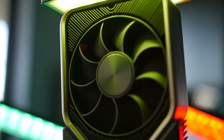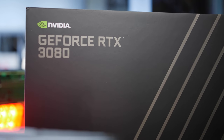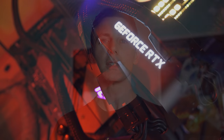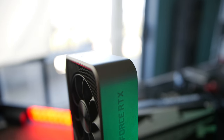In today's video I've only shown two models out of the whole series. The models I had here were the RTX 3080 Founders Edition and also the ASUS TUF Gaming. Both of these had HDMI 2.1 and they worked fine with the LG C9, so I can confirm that this combination will give you 4K OLED 120Hz. One important thing to note: this is only for the 3000 series. Older series graphics cards like the RTX 2000, and also AMD counterpart cards, don't have native HDMI 2.1 at this point in time, so they won't give you 4K 120Hz support over HDMI. And since the LG TVs — at least the 2019 and 2020 models — only have HDMI 2.1 in, you will need one of these 3000 series cards, or future upcoming graphics card models, to get this combo.